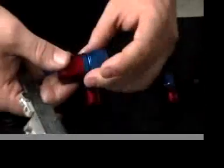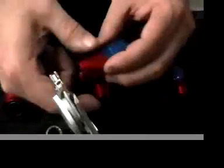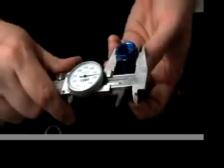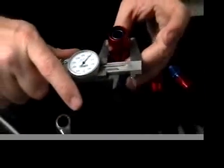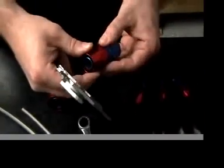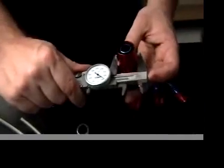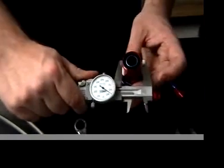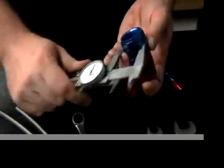On the -8, it is the only one of the hose ends that has the same size socket as the B nut. Both the socket and the B nut are 7/8. On the -10, we have a 1 inch B nut with a 1 1/16 inch socket. -12 has, actually, believe it or not, also similar to the -8, but not quite, 1 5/16 inches on the socket, 1.25 inches on the B nut. Who knows why they did that?